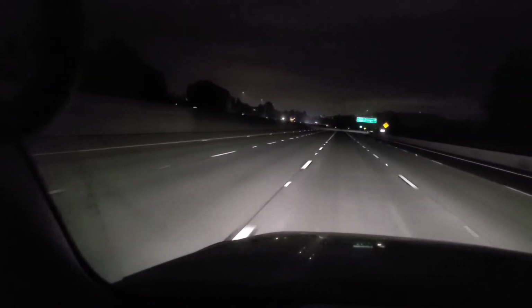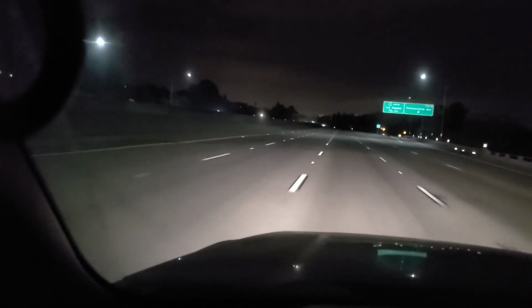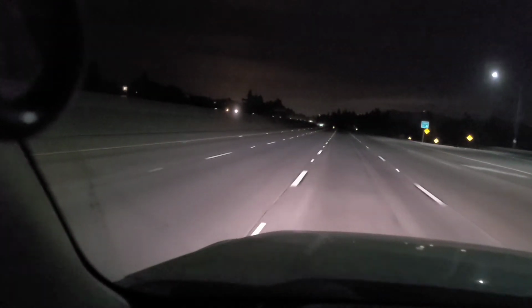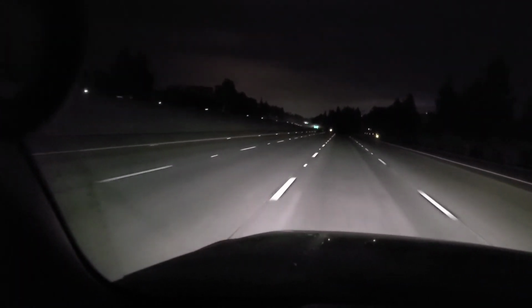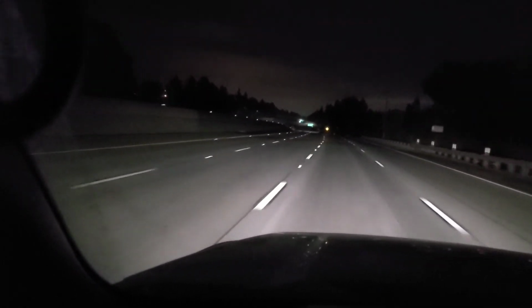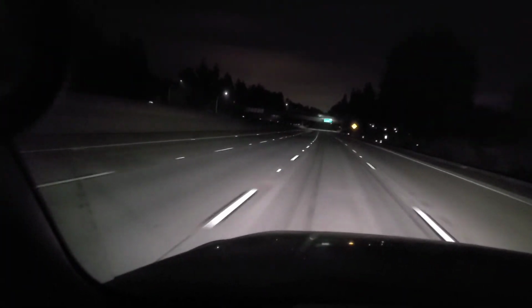And again, guys, I strongly recommend the air brake setup. The hydraulics work, but there's no comparison in everyday stop and go traffic or even a panic brake. Air brakes will definitely make a night and day difference. Anyway, that covers the different types of braking systems available on box trucks. Those are your service brakes.